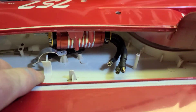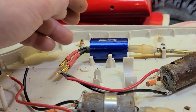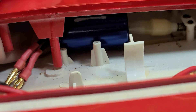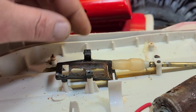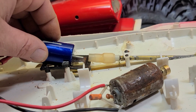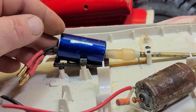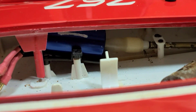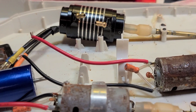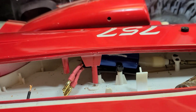TP4060 — a Traxxas Venom brushless motor on there. We could put an angle on it like it's supposed to. That's the 380-size brushless motor and these are 380-size brushed motors. I could probably just get away with replacing the old brushed motor with a direct-fit 380 Traxxas motor with just a few modifications. Old school with a copper tube to cut down on space — 3S per side with this smaller motor. I wonder if it would get up over 40 miles per hour.